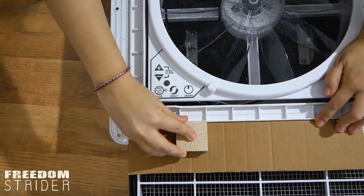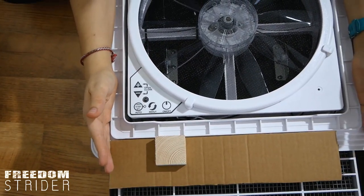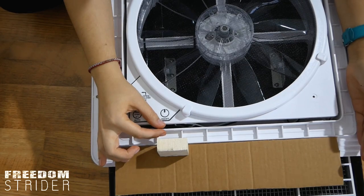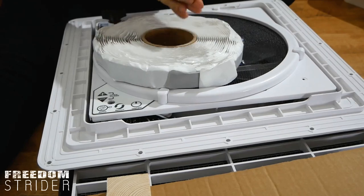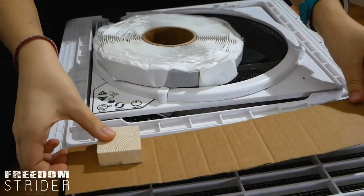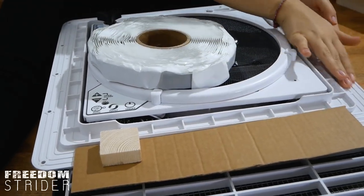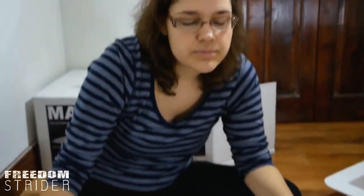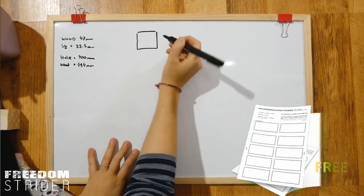That means the actual frame has to make a hole of 40 by 40 centimeters, because that fits perfectly in the center of the cube. If you build your frame 400 by 400 and cut your hole 400 by 400, then the skin of the van sits flush and you end up with a wall and a gap. We were pondering what to do with that gap, but we've decided to go as instructed and cut both the frame and the hole 400 by 400, so these ribs can do their job the way they're supposed to.